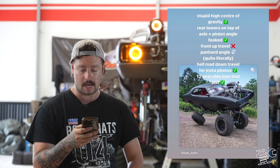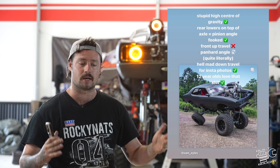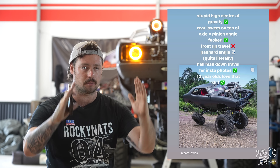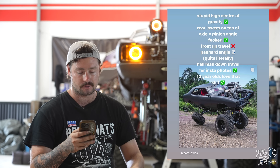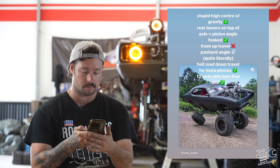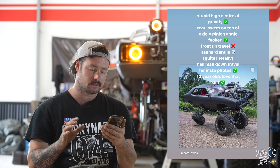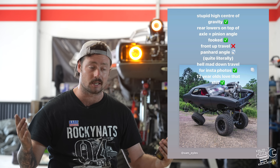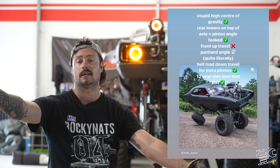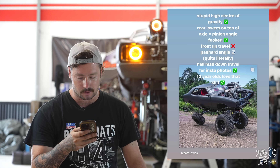Up travel — that was actually a stuff-up on my part. Because of the width of the diff, I built the chassis to match the car, and then when we decided what diffs to put under it, I didn't have enough narrowness there. So to put them any higher they would have failed on the chassis on up travel. We're either going to go smaller shocks on the front or have to notch the chassis — I just didn't have time to sort that out. Panhard angle — this kind of changed halfway through the build. I originally was going to do a normal steering setup with a panhard, but halfway through I discovered you could run hydraulic steering with a ram, which completely eliminates your drag link. If I knew that at the start, I would have just four-linked the whole front end and got rid of that panhard.